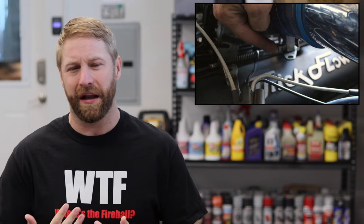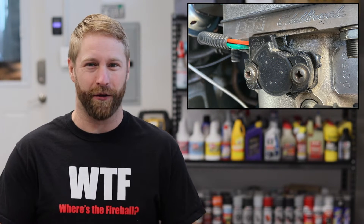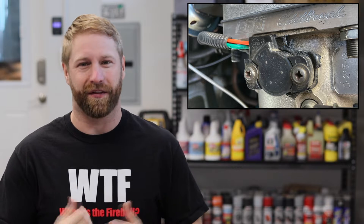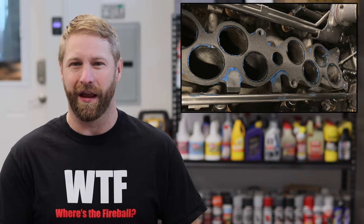After that we are going to set that base idle. The car is idling pretty low, it's surging a bit, and it's not happy with where it's currently set, so we're going to set that correctly. Thirdly, the throttle position sensor — I just cannot get behind the sensor being held on with RTV. The previous mechanic really loved his RTV in places and ways you should not. So let's get in there and replace that throttle position sensor.